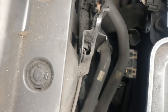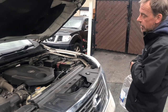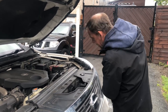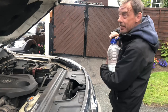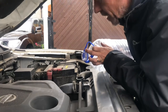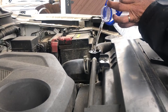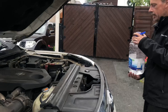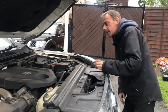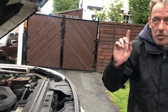What happens is when the coolant pressurises it can throw a fault code on those pumps anyway, so I'm not just going to dive in and throw a set of pumps at it — they're about 320 quid for the pair. Our channel and our videos are about saving time and money on repairs. This bottle of water was in the back of the car, so we know the customer has had an issue for a while. I've cleared the fault code and now we're going to start the car and do a combustion check.